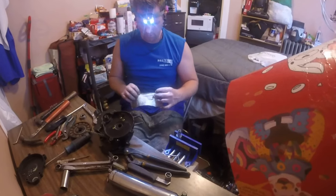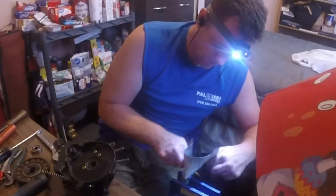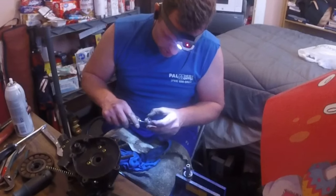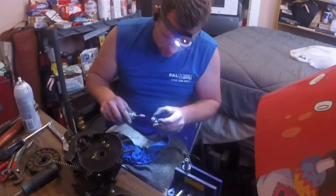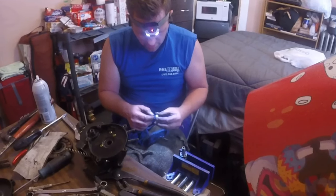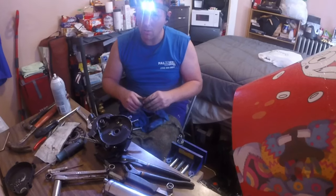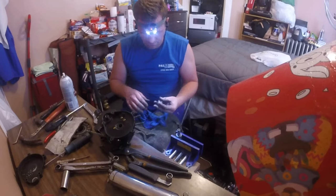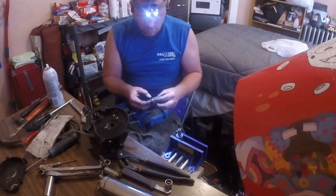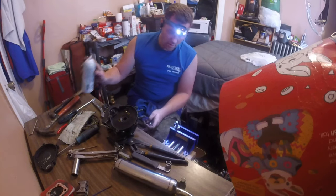All right, guys, not sure if you can actually even see what I'm doing here, but if not, no big deal. I really turned you on so I could talk to you. Yesterday, when I was about to take it off the bike, I test drove it one more time just to see what exactly it was doing, to get my head wrapped around it, make sure everything's okay. And I noticed it didn't really do it when the engine wasn't warm. It did it a little, but not like when it warms up. So right there, that tells me something's letting go. It was just very hard to tell where it was coming from.